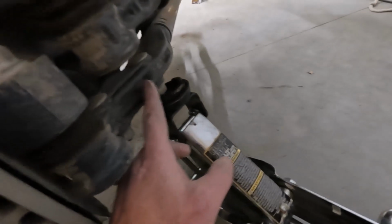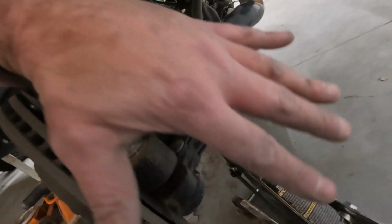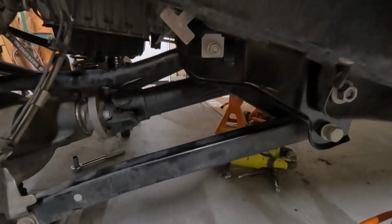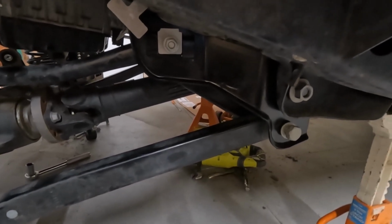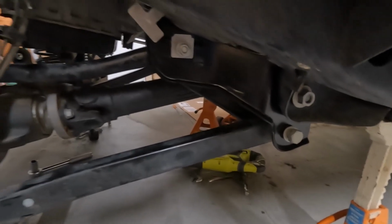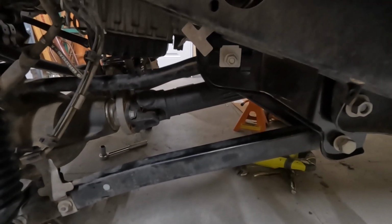It'll work. My solution for rolling the axle like the instructions mentioned was to take my little floor jack and put it on this brace. Sorry, I don't know the name of it. So that when it lifts up, it kind of spins, as we're looking at the camera, counterclockwise, and I think it worked. Look at that. Brackets. Look at that. Relocation brackets on. Front and rear control arms are on the driver's side. Time to do the passenger.